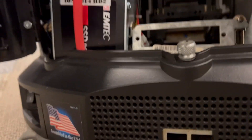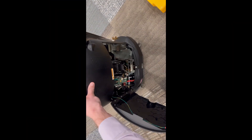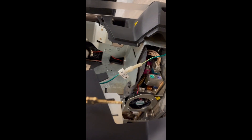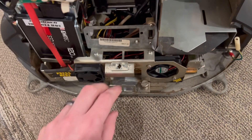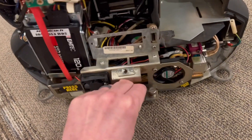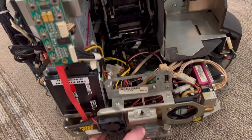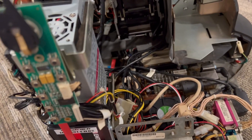I'm going to unscrew that and then we're going to slide it straight up. So I have that unscrewed now — I'm just going to lift that straight up. We've got to be careful because there's a green cable over here connecting these, so I'm just going to disconnect that. Next we're just going to unscrew this thumb screw. There's a tray here that's going to slide straight out, and then the motherboard comes out here.